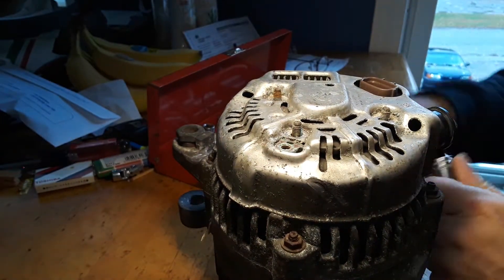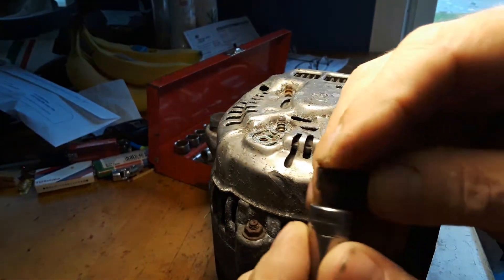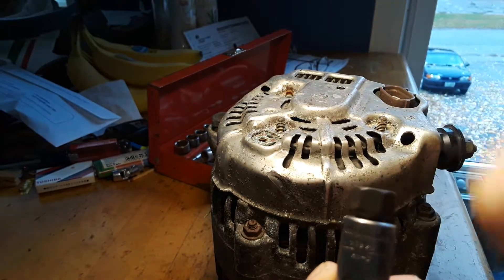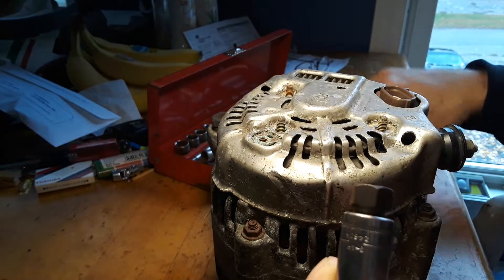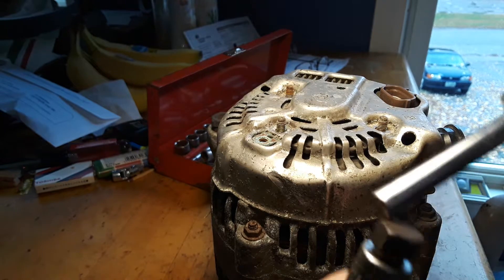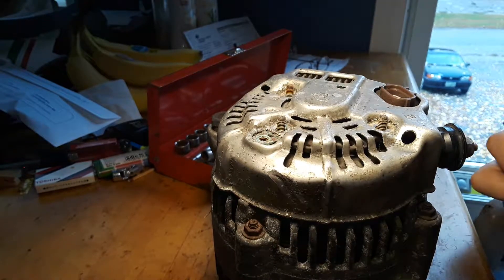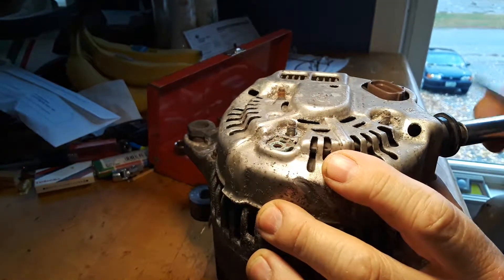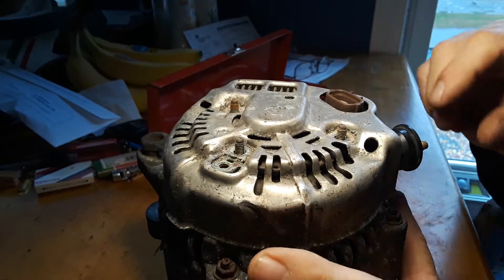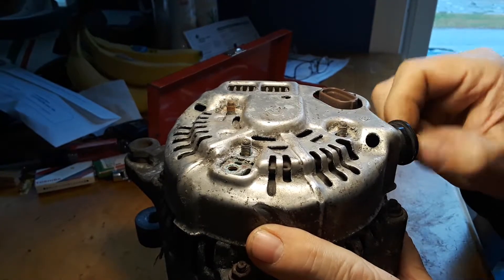While we're here, I'm just going to spy this in the toolbox. I don't know if you've ever seen these — they go in the back of a socket like that, and you put a wrench on them. So if you don't have the right socket drive, or maybe you don't have enough room, you can see this is a lot lower profile and you can get a wrench on them. They're pretty handy. I got them at Harbor Freight cheap — they had the quarter, three-eighths, and half-inch all in one package. You can't really go beefy torquing on them, even though they're black and kind of like they're tempered for impact use — I really don't think they would stand up to impact use.